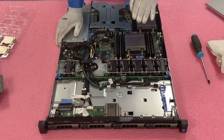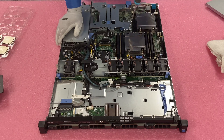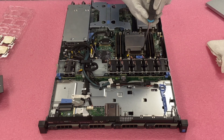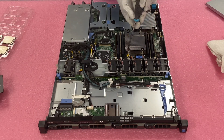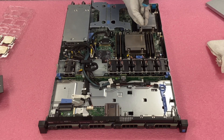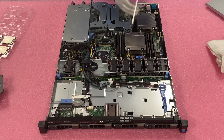We'll show you step-by-step how to remove your old CPU and replace it with a new one. All you need is your Phillips head screwdriver. I like to do a zigzag pattern — start here, then come across and work my way around. I prefer a manual screwdriver personally, so I get a better feel for it as the screw comes up off the motherboard. One thing I noticed with the R430s is the heat sinks are on there really tight — same with the latches on the CPUs.